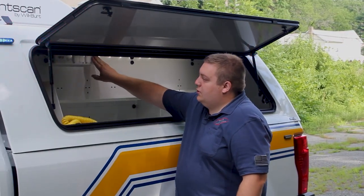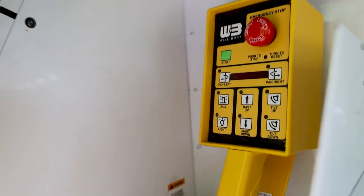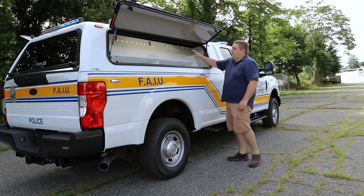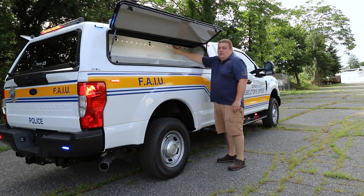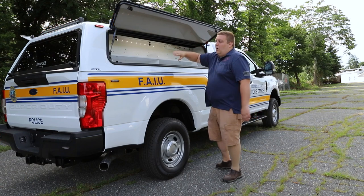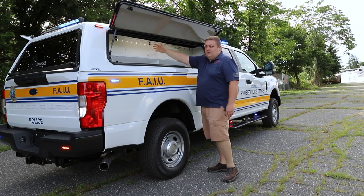We've installed strip lights on both sides. These tie into the inverter system through the breaker panel, and we also have the light tower controller in this panel. Looking at the passenger side compartment: open shelving, toolbox compartment, and a 110-volt strip compartment. We have our LED strip lighting installed with pin switches tied in with all the others — they all turn on individually, so if you open this compartment only this light turns on, and if you open the rear hatch only the rear hatch lighting turns on.